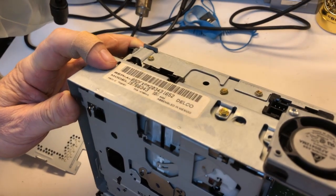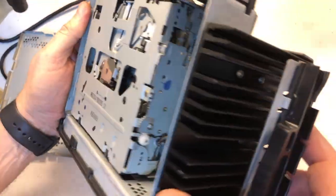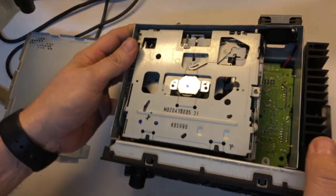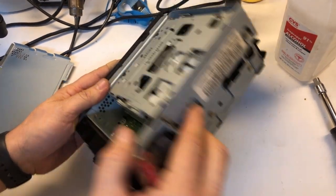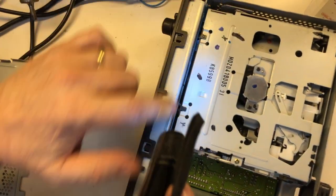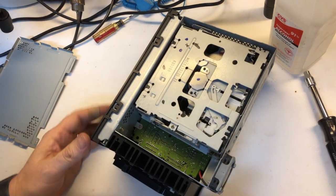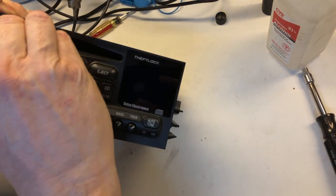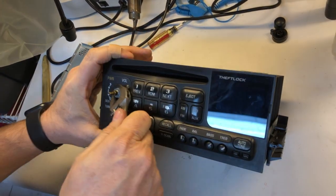What we're interested in is seeing if we've got gummed-up dirt or crud on the laser. There are two screws here — these turn out to be 3/16ths English. Looking at it, I can see there are also fasteners down in the front as well, so we're going to take the face plate off to get everything out so we can give it a thorough cleaning, which I think is what's causing the error.